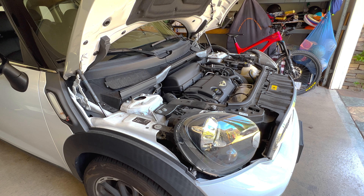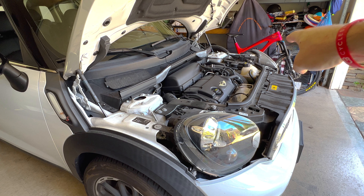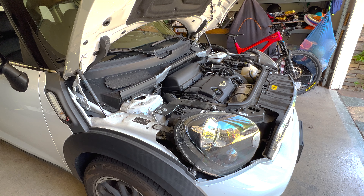This is my sister's car. She called me this morning and said there was a big puddle underneath her car, so she sent me a picture and there was a massive trail of coolant just everywhere. I went over there with my dad, we topped it off with some distilled water, and then I babied it home — made it no problem. It's been sitting here for a couple hours now and it's leaked like a drop, so it's an intermittent leak. I've been noticing over the past couple of weeks that coolant has been disappearing from the reservoir, so there is a leak somewhere. It doesn't leak when it's sitting; it must leak while it's driving.